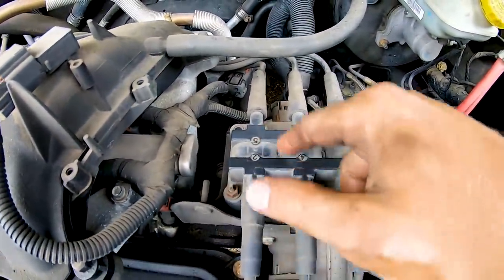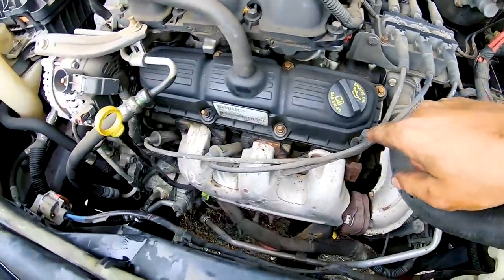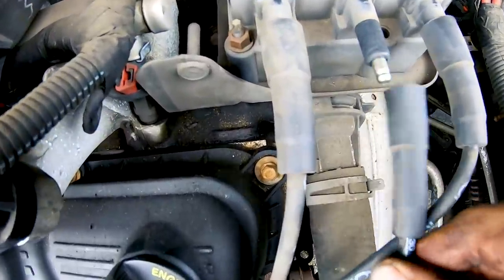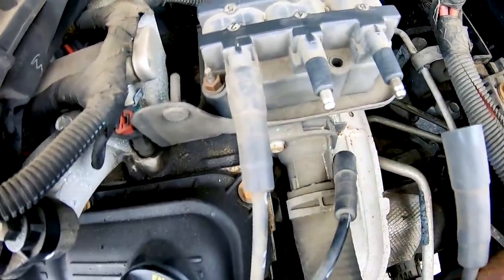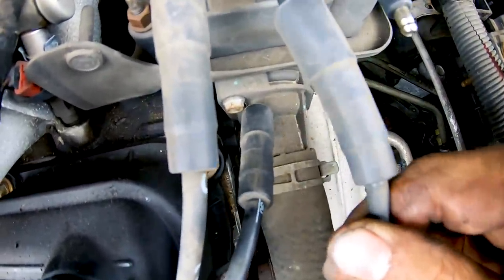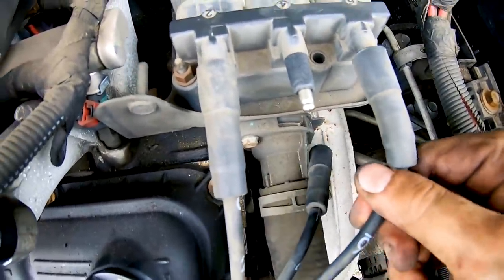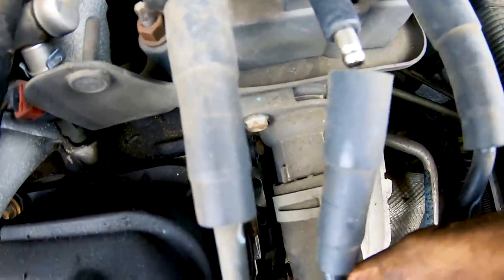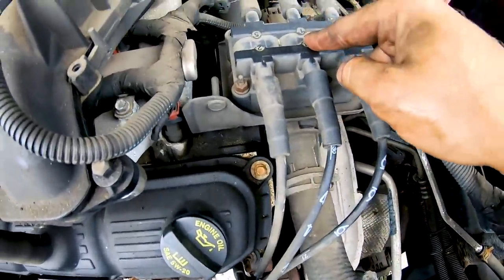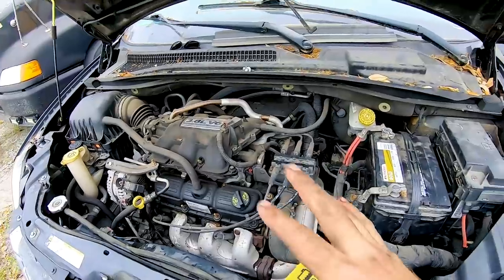It's pretty cool that these coil packs have everything labeled — cylinder one, two, three, four, five, six. There's our cylinder four right here, and the spark goes right there. This is our distributor pretty much for these models, and there should be spark coming through here, which there isn't. Let me unplug number six and show you — number six is firing, but if I put number six connector to number four, it's not firing. So there could be a bad connection, but that's not very likely since six works fine here. I think it's the coil pack. They're pretty cheap at the junkyard.